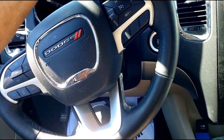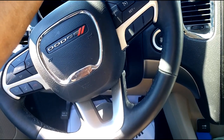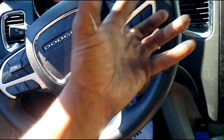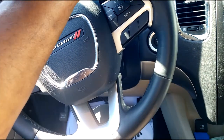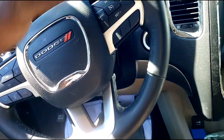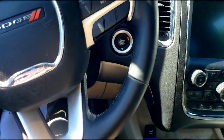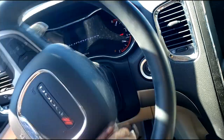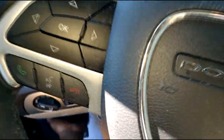This one's in for a cooling leak, and I'm not sure I'll get to go inside the engine. It's not likely to be the oil filter adapter housing because this is a new and improved version. It's overheating and losing coolant, so I don't want to run it too long. Let me check the coolant reservoir.